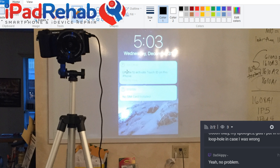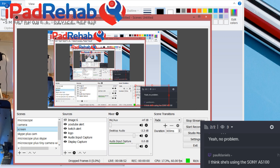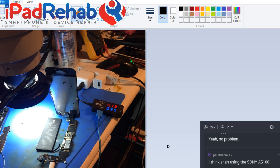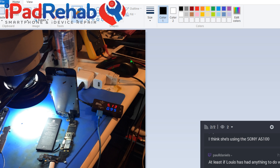Now here are the results back to normal after adding a new TriStar. You can see the dongle is working now that the 3v0 accessory line is back. And here is normal charging — 1 amp through the accessory dongle. The accessory dongle is white and the USB cable is blue. With 3v0 deleted it was down to 0.5 amps, so half — the default rate of half an amp.